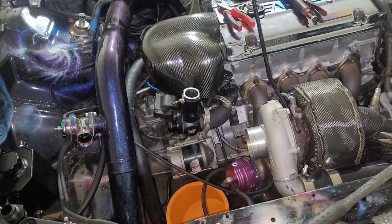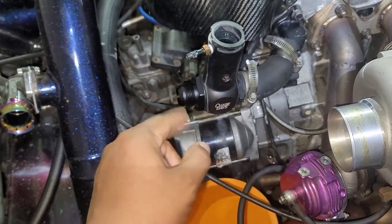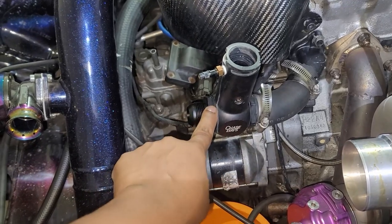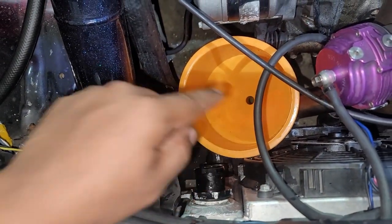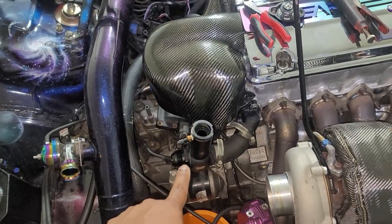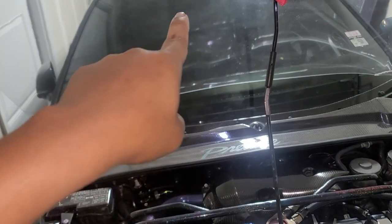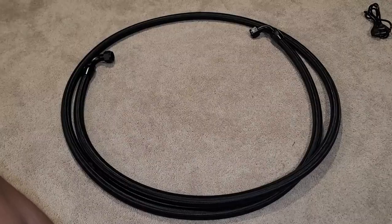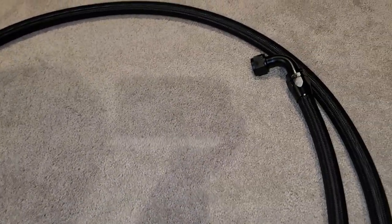On to the plumbing phase. This originally had a push-style fitting — I took that off. If you haven't seen my tucked radiator install, I'll put a link in the description. I went to Chase Bay's website and got the 16AN inline fittings instead of the push style — I got two of those, one goes here and the other goes here. I'm going to route it from here, down under the car to the radiator in the back, and then from the outlet of the radiator it'll come back and go into the top of the tucked radiator. You gotta be an absolute animal to put 16AN inline fittings together.